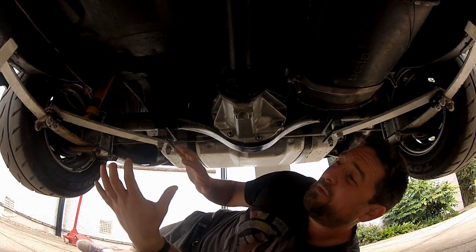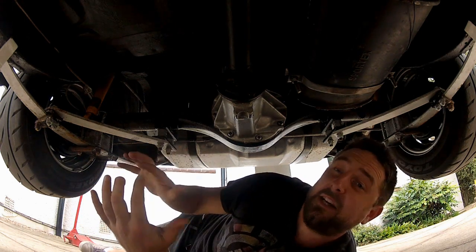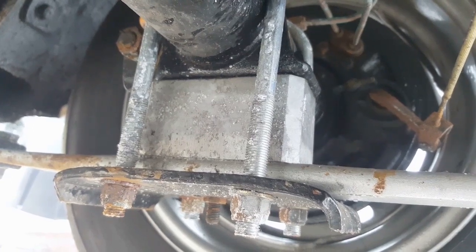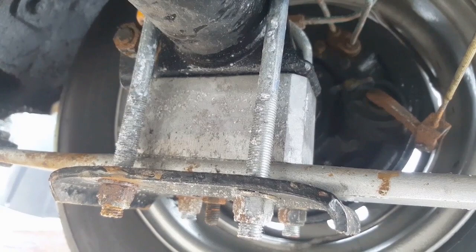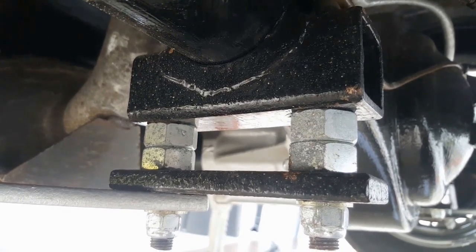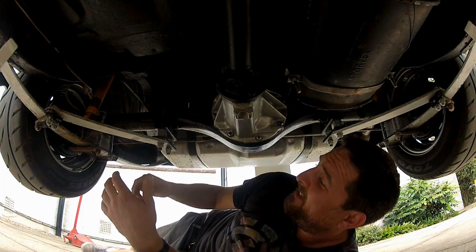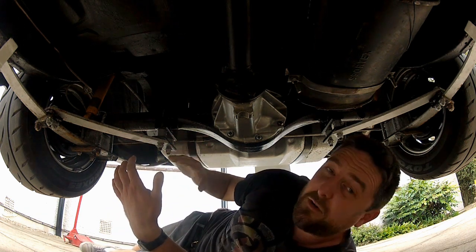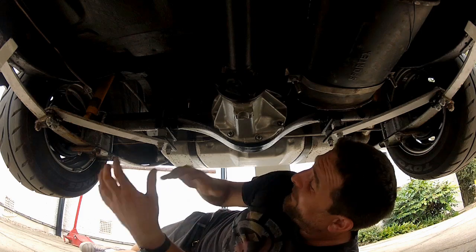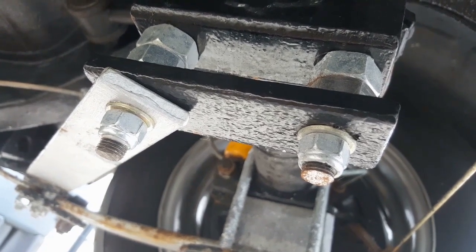When it comes to installing these kits, there are a few things to consider. First: is your car lowered? That will affect the fitment. When the weight of the car is on its wheels, you want the triangulation bars to be level. If you've got lowering blocks fitted like I have, this shoves the axle upwards relative to the leaf spring, so you need to bring the axle-end mounting point downwards to accommodate that — that's what these nuts are for, acting as spacers. With the bar so far down the shank of the U-bolt, I worried it might bend or break under hard cornering, so I cut another piece of 10mm steel bar, drilled it, and slotted it over the ends of the U-bolts as bracing. So far, so good.